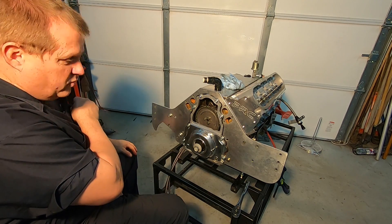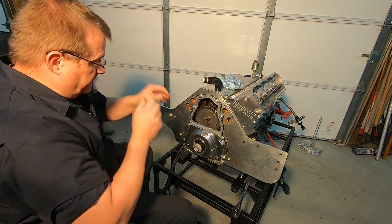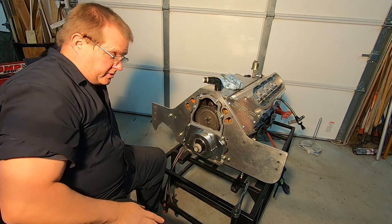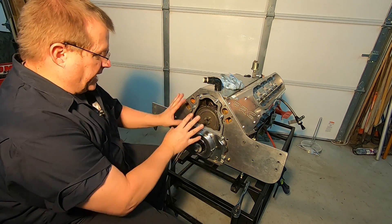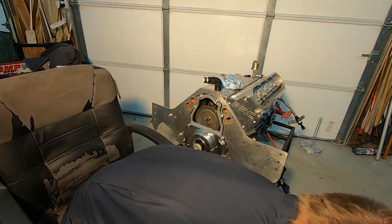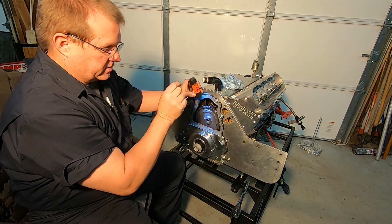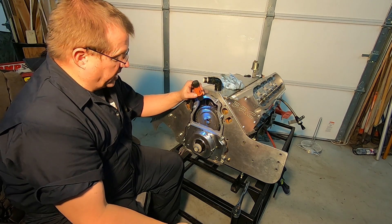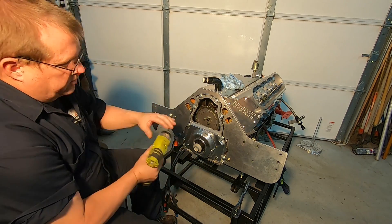In theory, all you would have to do is basically pull your timing bolt or timing bolts on the sprocket and remove that. But most importantly, you want to make sure it's at top dead center. This one's already set up at top dead center — when I had it off, I set it all up. You have to make sure it's at top dead center. Shine a flash right down, and on the end of the sprocket there's a little dot — make sure it's pointing down, then you know it's lined up dot to dot. Once you've got that lined up, all you have to do is pull these bolts off.